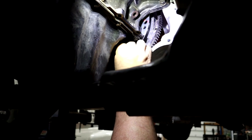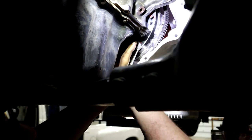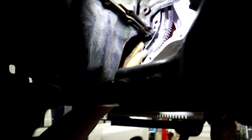This converter is a 90-degree converter, meaning all the bolts are evenly spaced. Chrysler started doing that in 1996 and up. All the older Mopars from '62 to '93 or '94 are offset — Chrysler did that because of the counterweights for externally balanced motors. We're going to make sure we're pulled all the way up for those counterweights. Once tight, on a small block you can probably get in with a torque wrench, but on a big block the only way to tighten the converter bolts is with a 'whammer' — that's the only way.